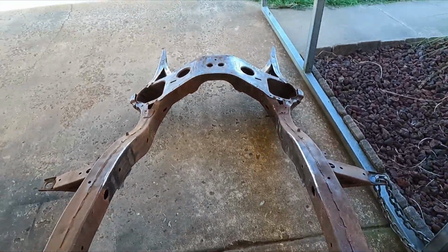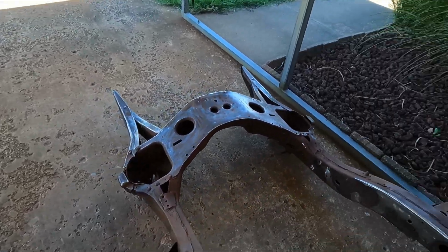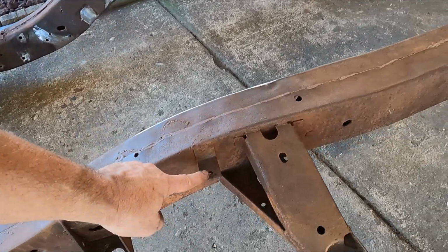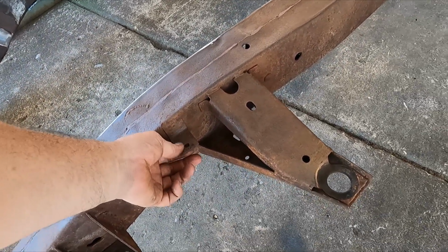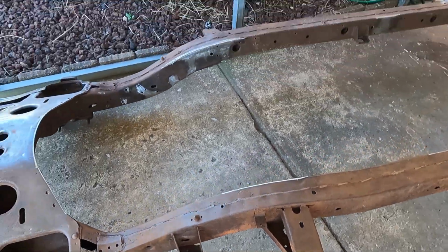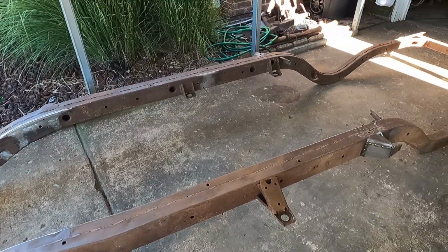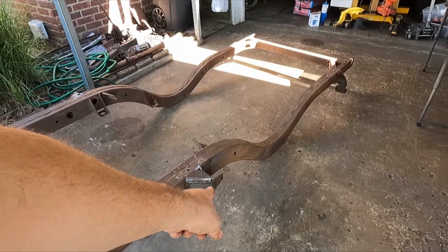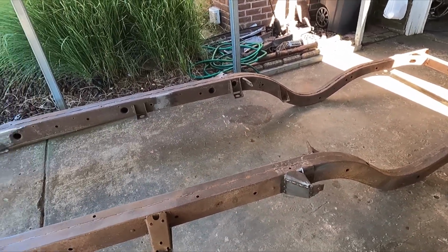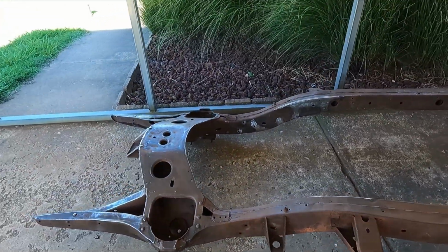But I am done for today. It is already 5 o'clock, so tomorrow when I flip it over, I'm gonna fix that crack, get the top pieces of the transmission mounts off. I gotta drill these splash apron brackets out, grind the tops, weld on some 1/4 by 20 nuts, and finish welding up the tops, just a few stitches on the top of the rock guards back here, and I think the frame will be done.